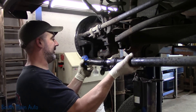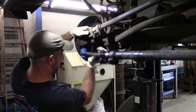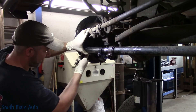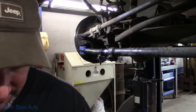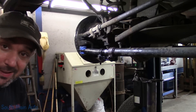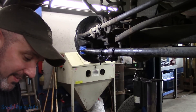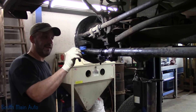We'll put this up on here, make sure it starts in that taper — there it goes. We're going to get the nut back on it. We also have to put the grease fitting in, which we have right here, and then we're going to have to get a new cotter key and stick that back in there also. Not too overly difficult. I thought this was going to be a struggle. We haven't touched the other side yet — there's things that can get real over there. Sometimes you've got to heat, beat, air hammer, swear, and throw a fit — then they come out.